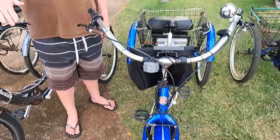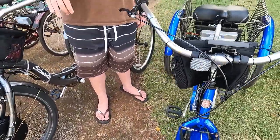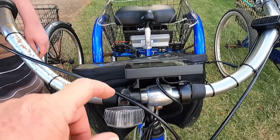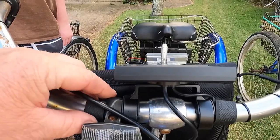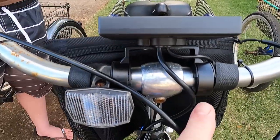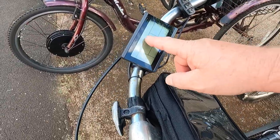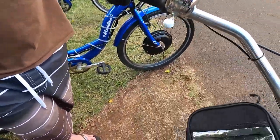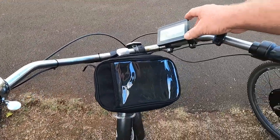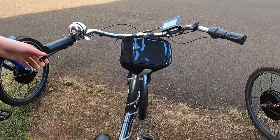Installation tip: centering the LCD display. With all these bikes you get a nice computer display that gives you all kinds of information for your ride. One problem is the screws that come with the mount aren't long enough because the handlebar bulges out slightly, making the little grips just a bit too big to clamp on. What I do is use zip ties through there to hold it together. It's much better to have the display in the middle of the bike — when you're riding and want a quick glance at your display, having it off to the side is not convenient. So this particular installation I'll need to redo before I can call it done.